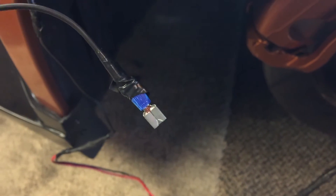I've got some quick release tabs on here so this end will be hardwired into the turn signal socket. If I need to take the bumper off, I don't need to unwire anything — I just unclip these. I'll probably put a little bit of heat shrink around these two. I'm not gonna be taking my bumper off too often, but it'll come in handy in the future.